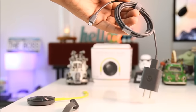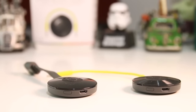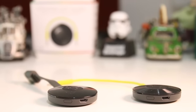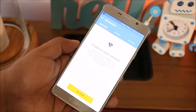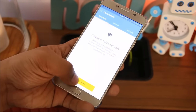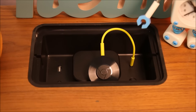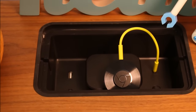It still comes with a micro-USB cable and power charger, but if your speakers have a USB port, it can get its power through there. To set up the Chromecast Audio, you will need to download or install the latest Chromecast app. Connect the Chromecast to the auxiliary input of the speakers and plug the micro-USB cable to a power source.